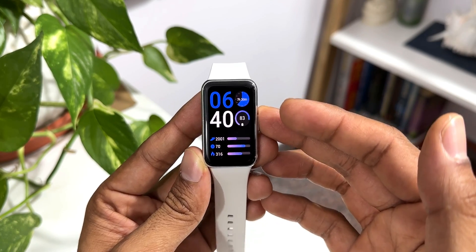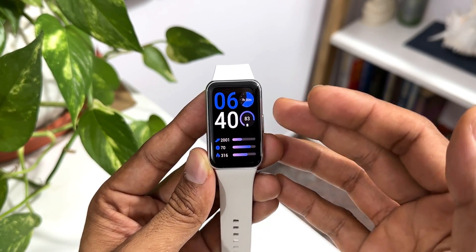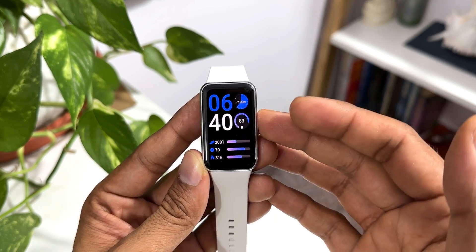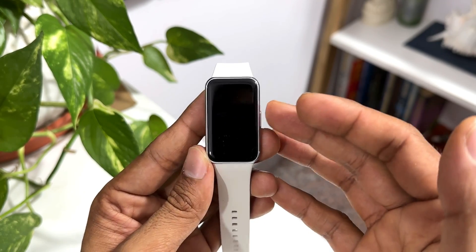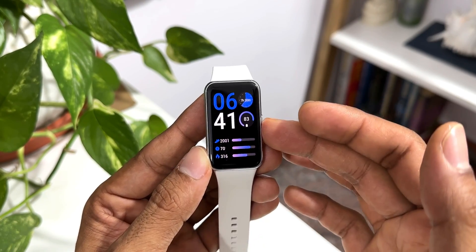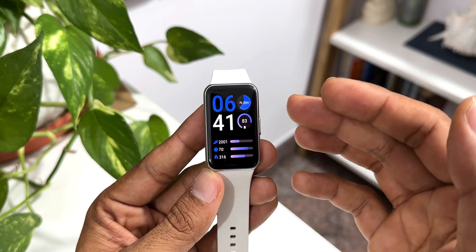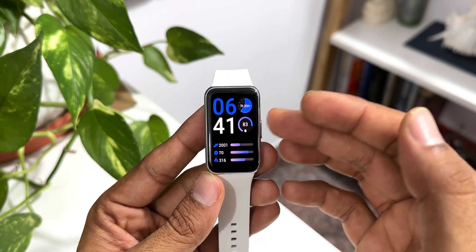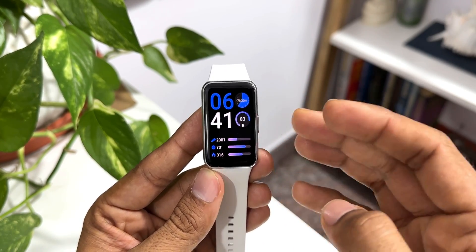The next question is: how is the battery life on this watch? I've used this watch for about two days and I'm losing about 15% battery per day. I have turned off the always-on display and set all health-related measurements like heart rate and SpO2 to manual — no continuous health sensor recording. So I'm assuming the battery life would be about five to six days, even though Samsung claims 13 days tested in their lab. I'll be doing a complete battery review soon. I'd also like to mention that this screen is very beautiful — it's an AMOLED screen with high pixel density and the text and images are crystal clear, which may be contributing to higher battery consumption.